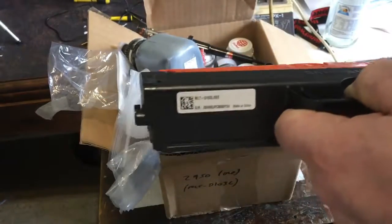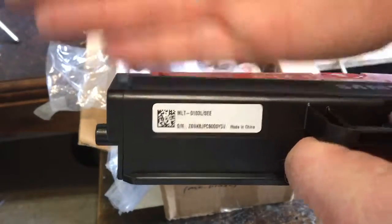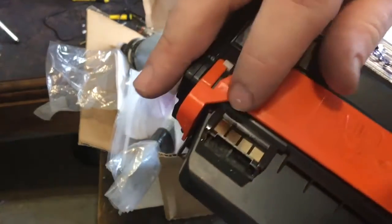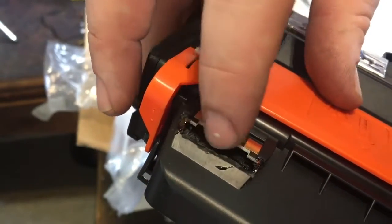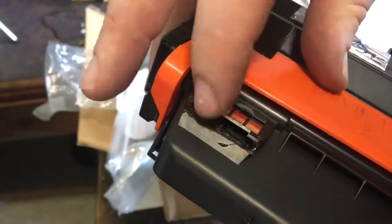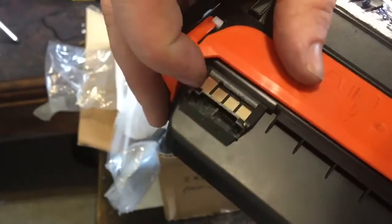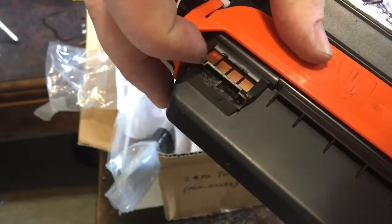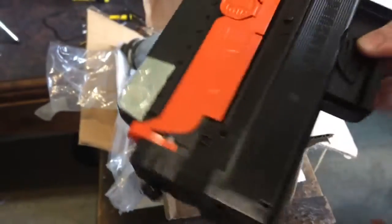So this is the cartridge we're doing. That's where the chip goes — on these original cartridges there's a little ledge on the end. If you cut that ledge off all the way along that lip on the front, you can slide the chip out and install new ones, securing them with a little bit of electrical tape. It's fairly solid and sturdy but pulls off easily enough when you want it to.